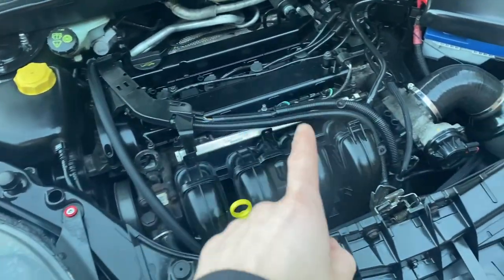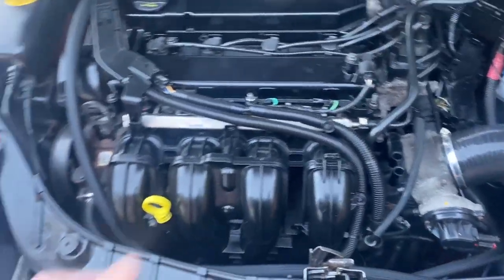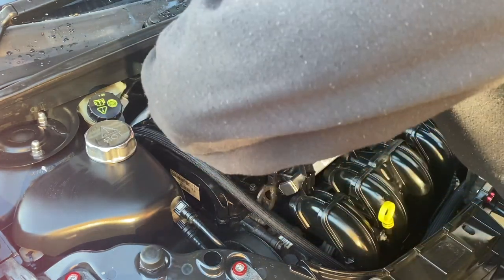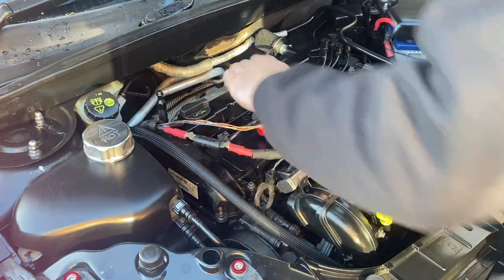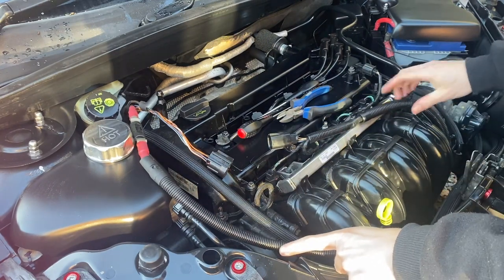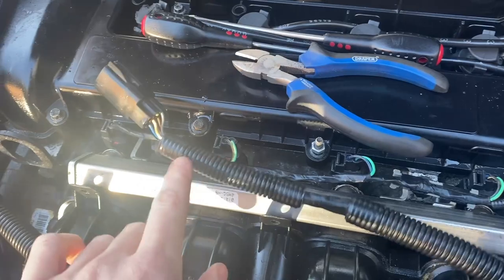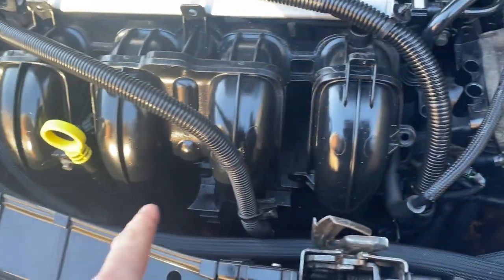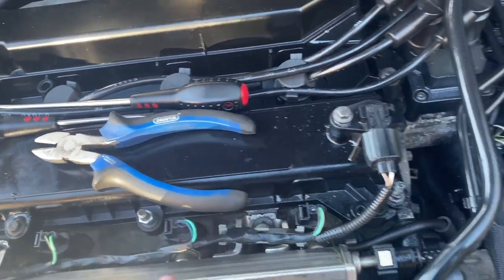There are just a couple of cable ties and plastic clips holding this tray on, so I'll snip those off. There's a little wiring harness here that I can disconnect and pull out. One of these looms has plenty of length to run all the way around. Next I want to see if I can get this plug back over to the other end. It's held in at the minute with all the injectors, so I'm going to strip the conduit off and hopefully separate the injector wiring from the wiring for this plug. I'll label up each of the injectors before I unplug them so I know exactly which is which, since we are going to be rerouting that wiring.